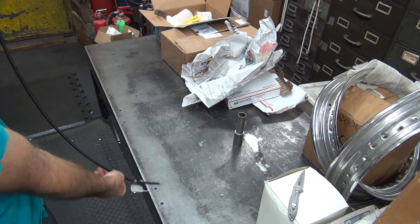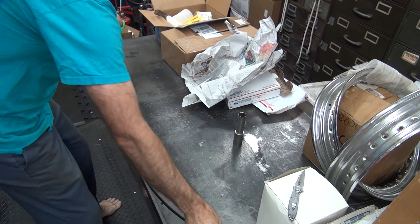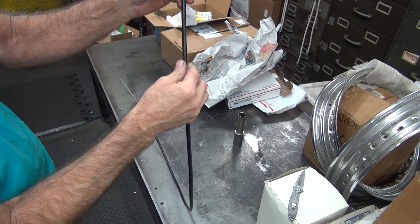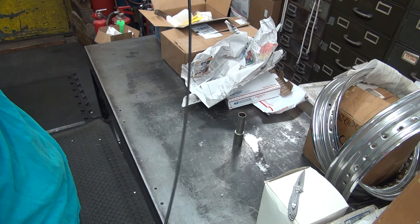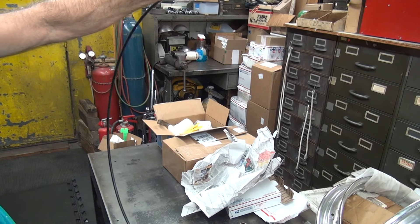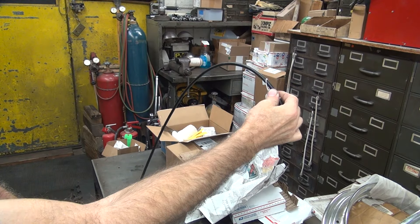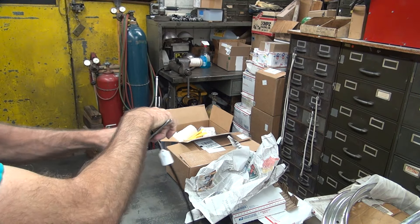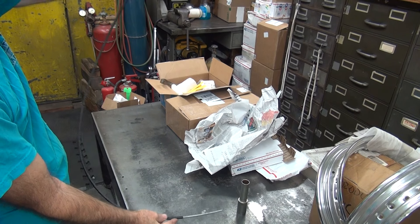So this is our cable, and it looks a little bit longer than a normal cable. I am thinking what this is, is the clutch cable — 45 hand clutch cable option. That would come off your right handlebar, go down the bike, snake down the center of the frame, go behind the motor, and stick over where the clutch is at. That would soak up a bunch of this length you have here.